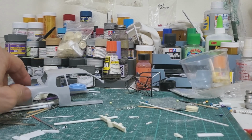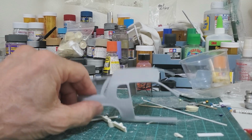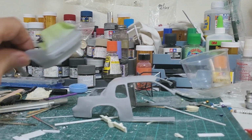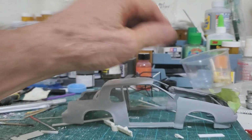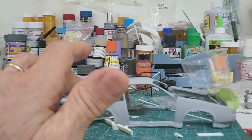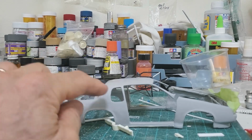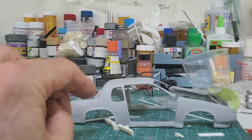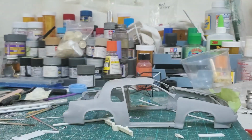And the Olds, same story. Body work, sand, fill, primer. But this also, I'm really close now. Soon ready. I think everything's primed. Actually, now I'm looking at the doors over there. I need to reprime the doors and maybe a couple little spots. And then I'm going to wet sand with 1000 grit and put everything together.